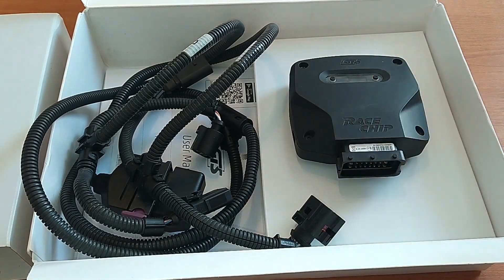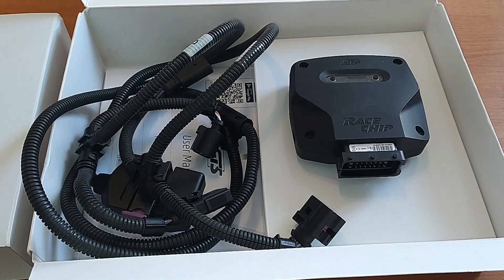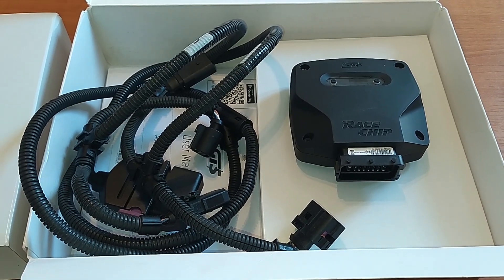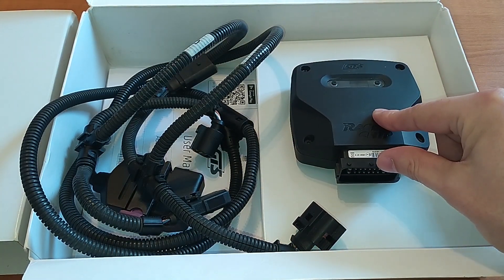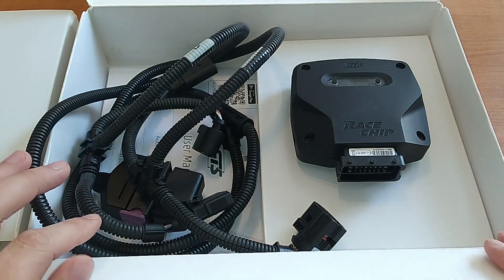I don't think there will be any gains in terms of maximum horsepower. To make good horsepower numbers you need to gain a good amount of torque at high RPMs, and on this engine that's not really possible. First, it has a tiny little turbo that is basically running out of puff at about 4500 RPM in stock form — so this box demanding even more boost from it is just not going to happen. The other reason is that the software in the ECU stays exactly the same — the same fuel maps, the same ignition timing maps. The only difference is that this tuning box is spiking the existing map with a bit more boost and fuel. So the box will not change the overall character of the engine one bit. That's my prediction — let's fit it on the engine and see what's what.